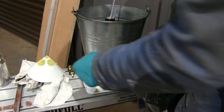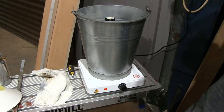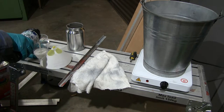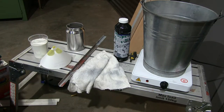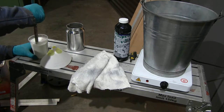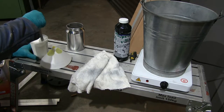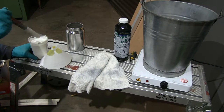I thought that if I heat the material up in a bucket of hot water, it should be much thinner and go through the spray gun more easily. But the conclusion I came to is that the whole hassle of heating it up is not worth it, because once you put relatively hot material inside a spray gun, it loses temperature quite rapidly since the gun is made of aluminium, which is a very thermally conductive material. So it totally defeats the purpose. Plus, if you use a 2.5mm nozzle, it sprays at room temperature — about 18 degrees Celsius at the time — very easily, and you can get a really fine finish.